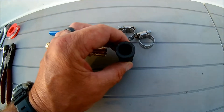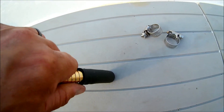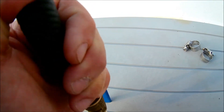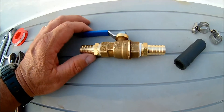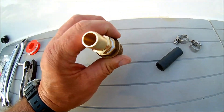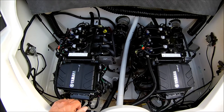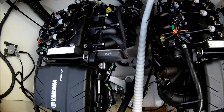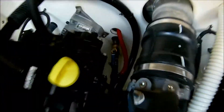Put Teflon tape on your adapters and tighten them in. Keep the Teflon tape away from the ends — you don't want any little pieces getting sucked into the engine. Here's the actual piece of pipe I've already cut. It's very tight but there will be almost no restriction — in fact it's probably less restrictive than the plastic fittings Yamaha uses. I already have one installed on my 2018 SX 210, so let me show you where these go.